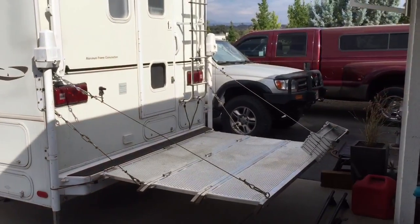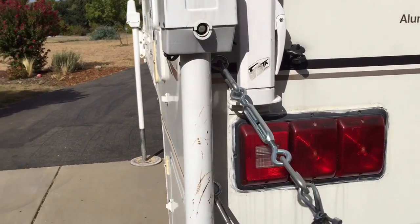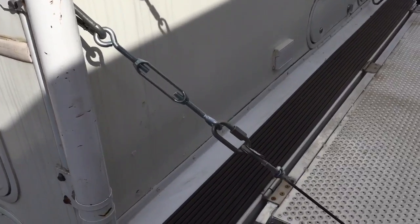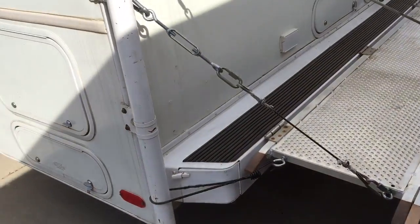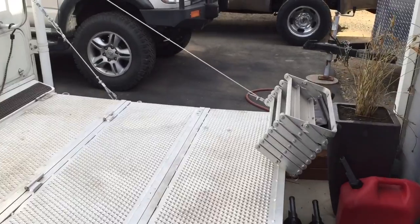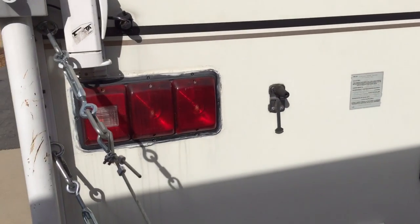Here's a full shot of it — you can see the cables coming down to support the ends. It's really stable. I've got carabiners hooked up to the eye bolts, which go through the rear jack holes. The stainless steel cable has a clear jacket on it that has discolored — I probably won't use the clear jacket next time. I have replaced these cables once, mainly because when I added the turnbuckles it changed the cable length.